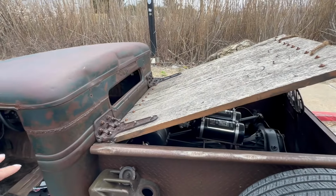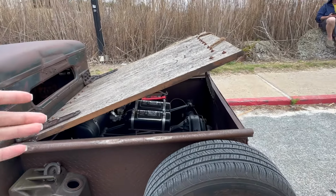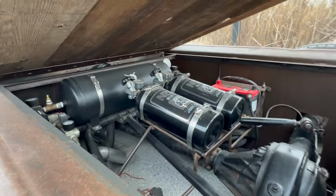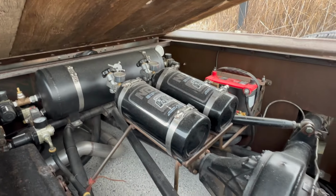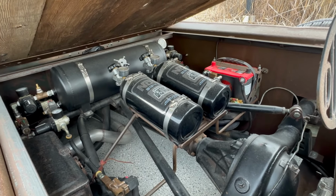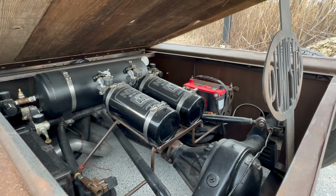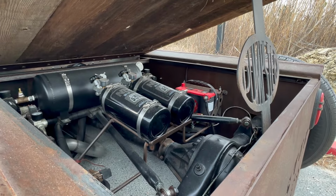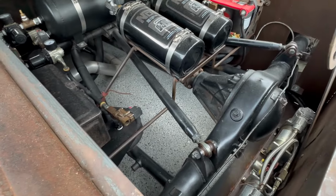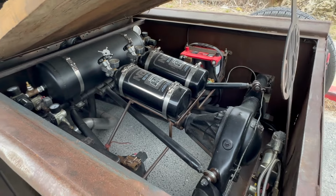The thing about the rat rods is the creativity behind it, the recycling that happens here, and of course, you've got some nitrous tanks here. So it's a four-corner airbag, and it's bag-on-bar suspension back here, and each bag has its own regulator, so I can regulate the pressure and ride around at 2 inches, where if I see a curb, I can pop it up to 4 inches to go over it. And the nitrous I have unhooked now to be legal, because Maryland would have a fit with me hitting the button on the steering wheel.